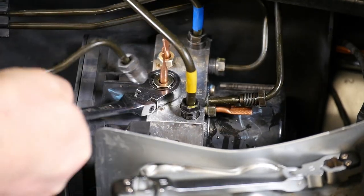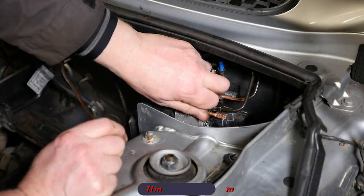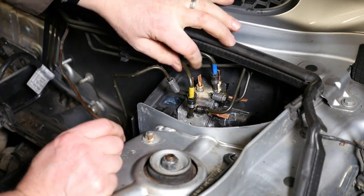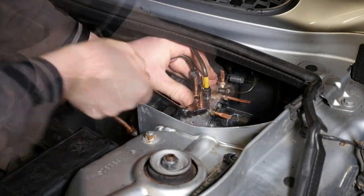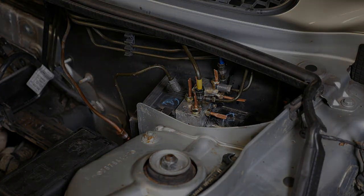The two larger unions on top are clearly bigger — I think these are M12. All the brake pipes are now off and I've plugged the last hole using an M12 union. We can now disconnect the multi-plug and remove the ABS module.